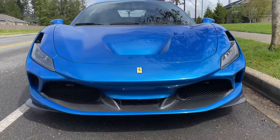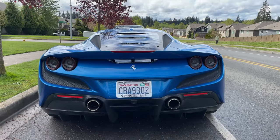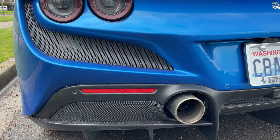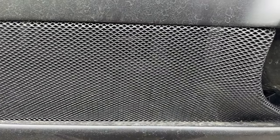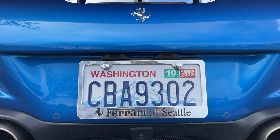Taking a closer look at the install itself — the front ALP setup is pretty straightforward. He's got two regular heads in the dual air intakes underneath the headlights, and then a TX head mounted in the center. The rear setup is what really caught our eye. The two regular heads are actually mounted behind the grill below the two taillights — it's pretty much impossible to see. There is a mesh opening in front of the heads, but they are otherwise completely blocked. Over the license plate there are what look like two TX heads, though only one of them is actually a TX head. They put an empty clone on the other side just so it looks symmetric.